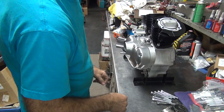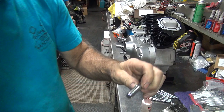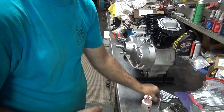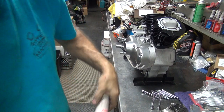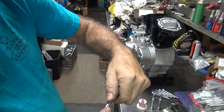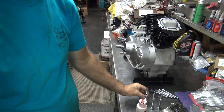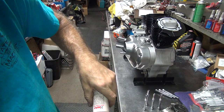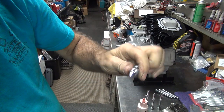So that's done. Now we take a little bit of oil and oil up our bolts here — put a generous amount on there, especially with chrome. Chrome likes to gall up instead of tighten. If you have the fancy ARP special thread lubricant, use that. You can also use a nice heavy transmission oil, rear-end oil. Hypoid works really good — it's got a lot of high-pressure additives in it, and it'll let you get a nice, true torque.